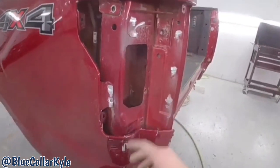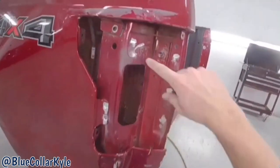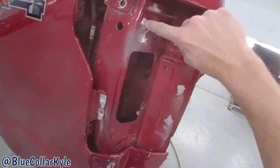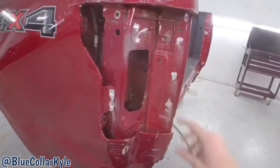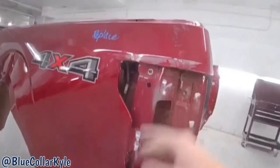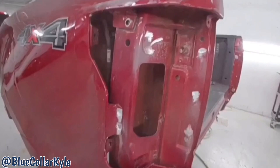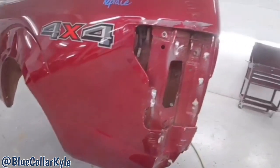I've had lots of people ask me: if this is aluminum, why is there sparks? Because aluminum doesn't spark. These are actually self-piercing rivets, which they put these panels together with — they're actually steel. That's what you're seeing spark. It's the self-piercing rivet, not the aluminum, because aluminum does not spark. So that's why you see sparks, but this is an aluminum panel.